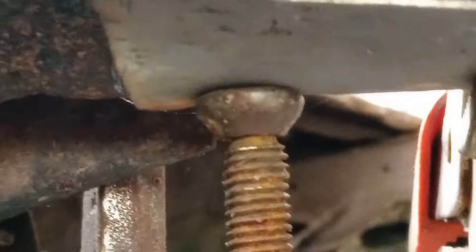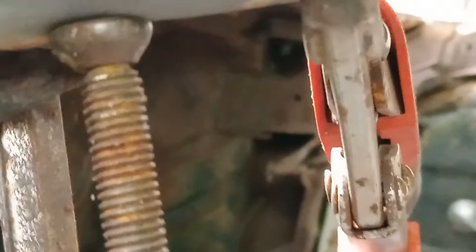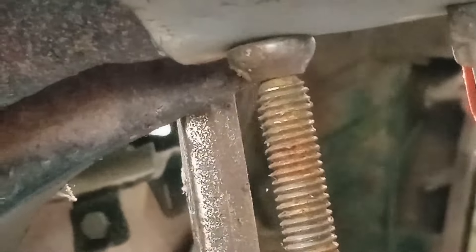She's pretty close there, so I think the shape is right. I'll tap it a little bit more with the hammer to get it closer, but it has the shape on it. Now I can cut it off right here and just weld it in, because that part of it's solid but it's got holes down here in the bottom.